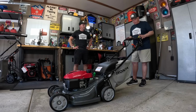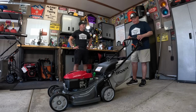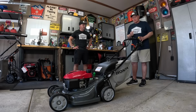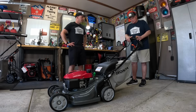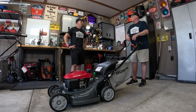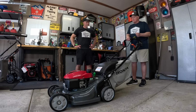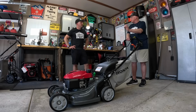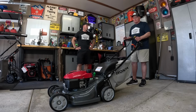Right. Same thing. I would wonder if this is going to be a problem in here with the blade control. Why? Because when you push down, you've got springs and you've got cabling that are all torquing on each other. Quite a bit of it. And some of that's going to stretch out over time. And so when you do that, will this pop up? I can tell you from experience that's going to pop up. And this is going to spread out. Springs are going to just lengthen a little bit. Cabling is, you've got a single tiny cable and you're pulling and yanking on it, and sure, that's going to stretch out over time. It's going to take a long time, we're talking like 10 years or more. Or even more.